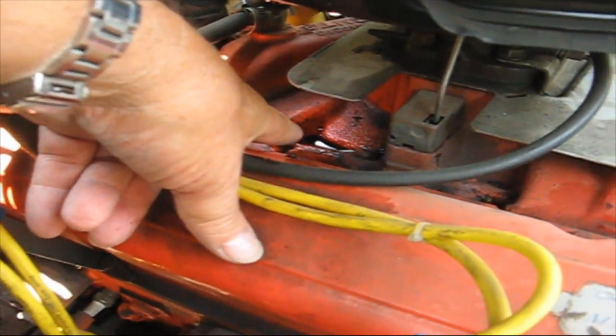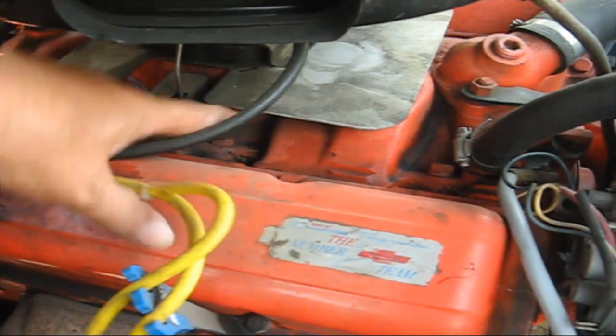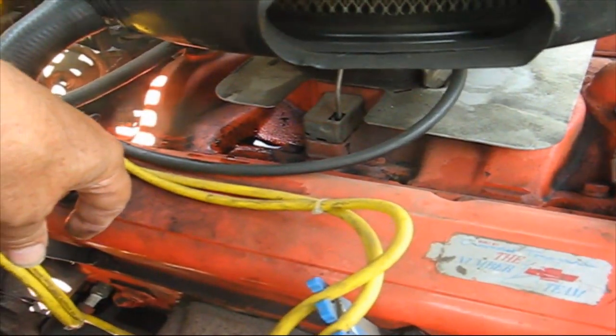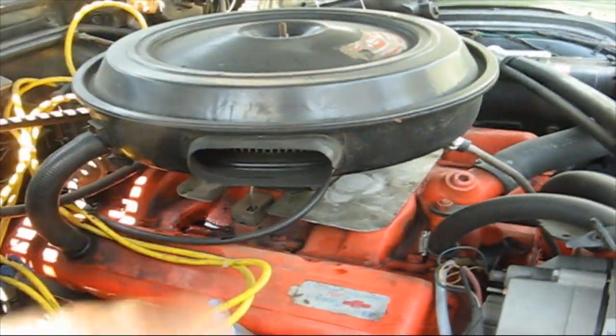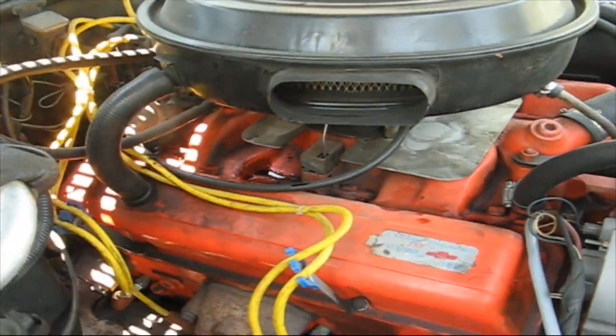What I have to do now is take off these bolts and put some blue RTV on the threads. I have to take the air cleaner and carburetor off so I can get at those bolts. Also, this is the original engine with the car.